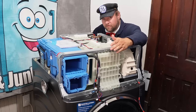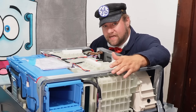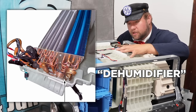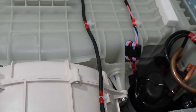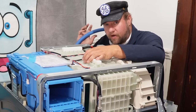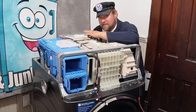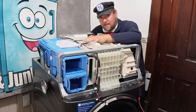The difference between this review and every other is that no one else is probably going to get to this point and show you why this washing machine works the way it does. Underneath are some coils, and with the compressor here, you can find out what really makes this work. This is essentially a dehumidifier packaged inside this washing machine, which works as a heat pump. It exchanges hot and cold air, which dries your clothes and rips the moisture out of the air, allowing it to work by simply using the drain hose to take the moisture out instead of a large venting hose.